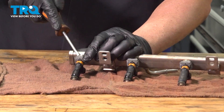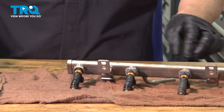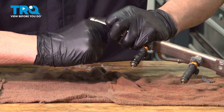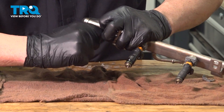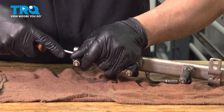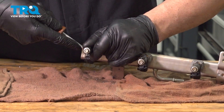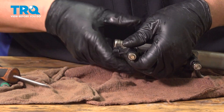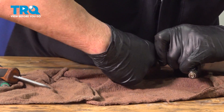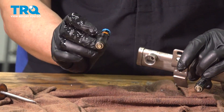Take these clips off — just use a straight blade screwdriver or a pick and slide that off. Then you wanna have some rags down because you might drip a little fuel. Just work this off — you can pry it out with a straight blade screwdriver. Twist it back and forth a little bit, it makes it a little easier. Take that out.